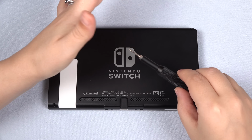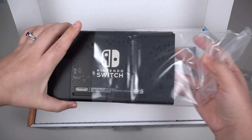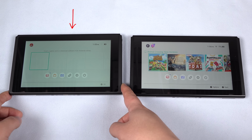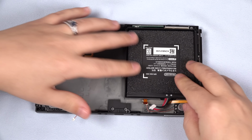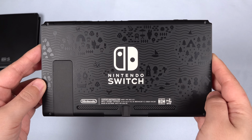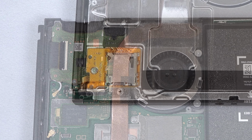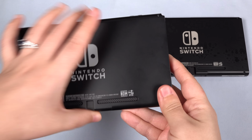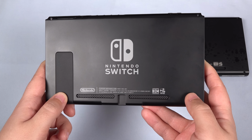I did just this for my husband, who got really attached to his original Switch but wanted the better battery life. So I took my Animal Crossing unit I bought, which had a terrible screen, gave the motherboard and brand new battery to my husband, then swapped the themed back cover onto my current V2 unit that I really love, which took me 7 exchanges to find a screen I liked. Note that I also gave him the new fan and the card readers because I wanted him to have new moving parts just to keep him future proof. Poor gutted thing. It won't go to waste. It got John's old parts and will probably sell it or keep it for parts.